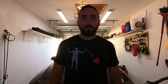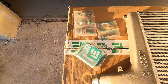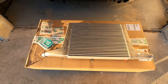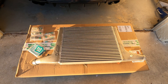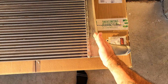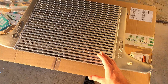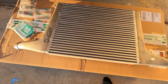But for today we've got the Audi behind me. We've got the intercooler. Let's see what we got going on. Here we have Integrated Engineering's FDS intercooler. You can see they gave you brackets, bolts, everything like that. You're probably asking yourself what is FDS? Well it's Flow Distribution System. Basically what FDS does is that it takes the inlet air and evenly distributes it throughout the entire core. Inside the intakes there's actually fins that help the air go up and across, whereas typically it would come in and stick to the bottom area and the top of the core wouldn't really be used all that much.